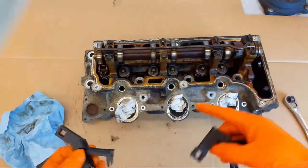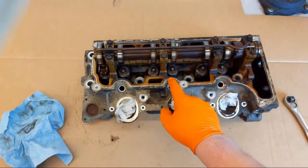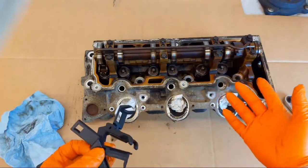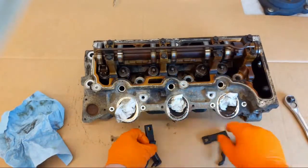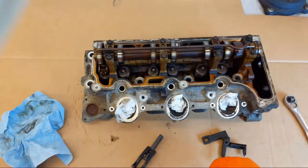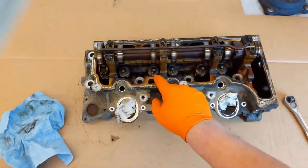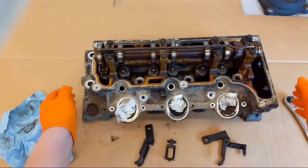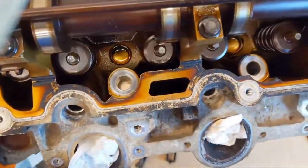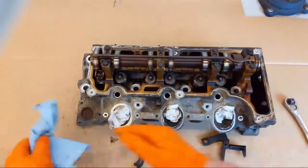Last time I had some issues getting out this valve spring here. I was expecting problems on these three but ended up not having problems — but this one in particular, because the valve spring is located so close to this aluminum part, this tool actually rubs against that back side of the head. You can see it actually made a couple of indentations in the aluminum.